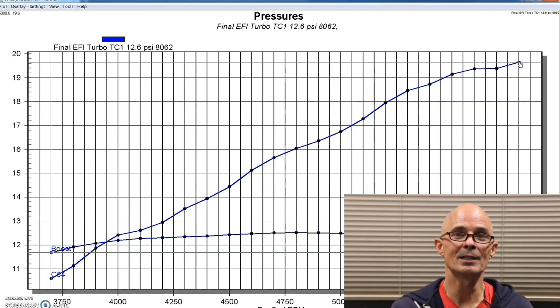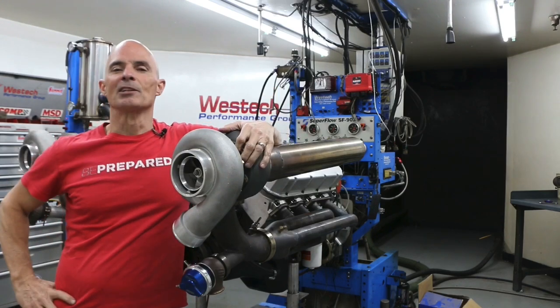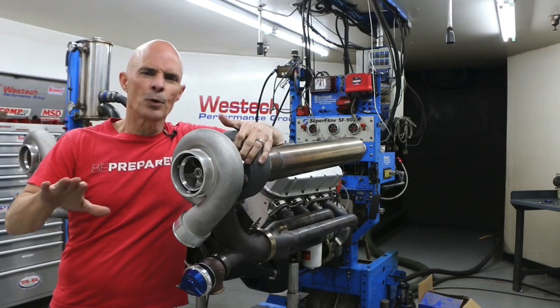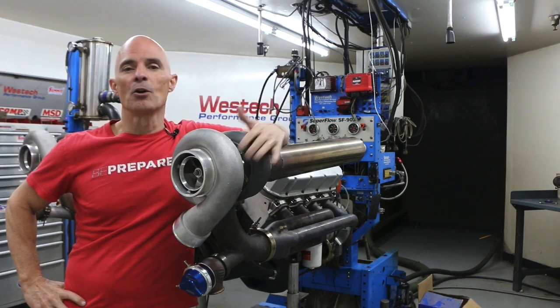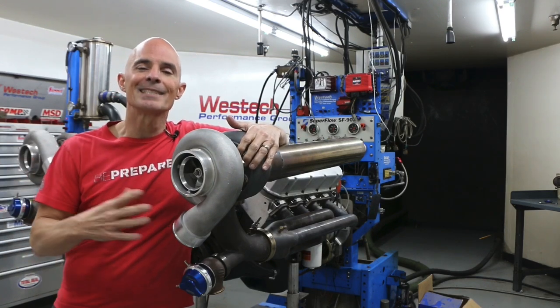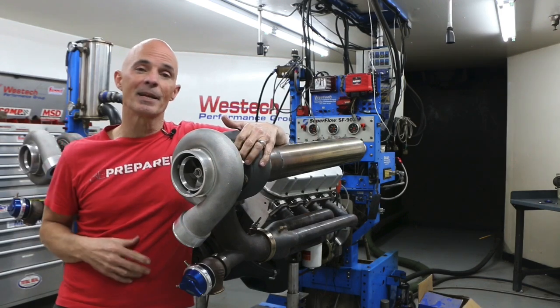Let's go really quickly to the conclusion and then we can say goodbye. Honestly, guys, we don't really even need a conclusion here. I went over everything in the results, but here's a quick rundown. Single versus twin eBay GT45s on a 454, definitely go with the twins. Unless all you want is tons of low speed response, a single is probably too small. The twins work great, especially if you want to make a ton of power.